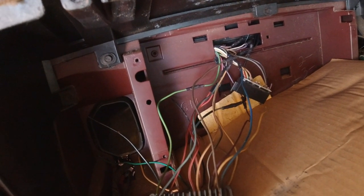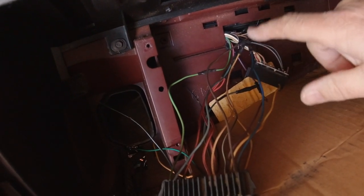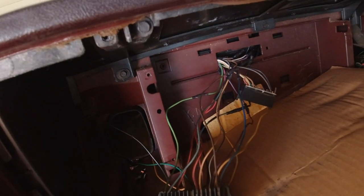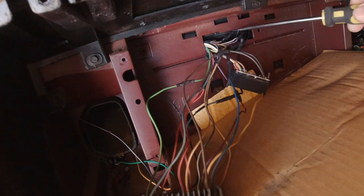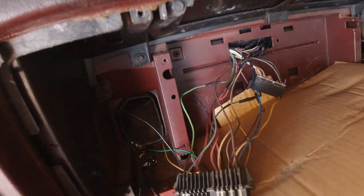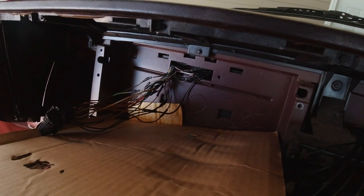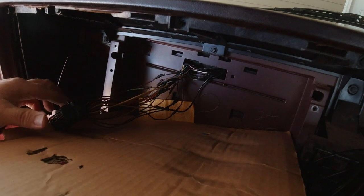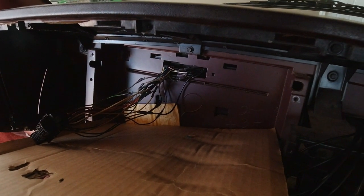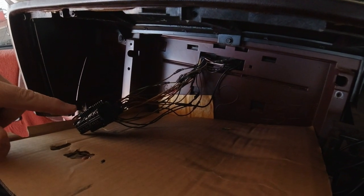I don't really see the need to cut the dash the way some people do online — I've got plenty of room with long enough wires. At the salvage yard I cut the dash to get as much of the wiring harness as I could rather than just sliding it out. I've now got all wires connected. Every color I had in my original harness is done, including a white wire which is supposed to be the tach wire — an unexpected surprise. I hooked it up anyway, and now I'll grab the gauge cluster, plug it in, and crank the truck.